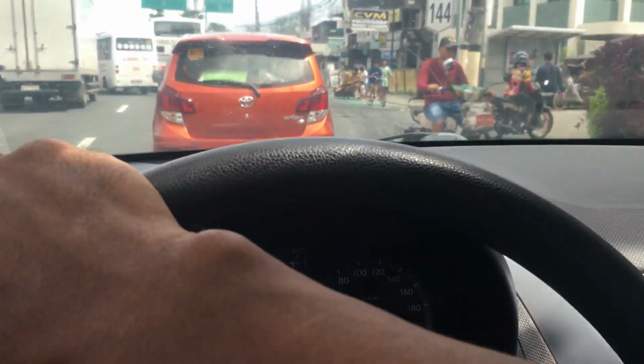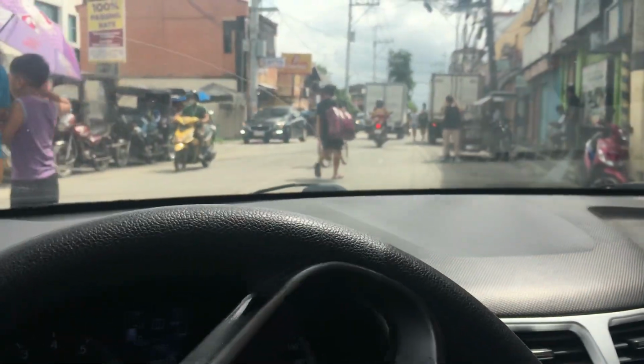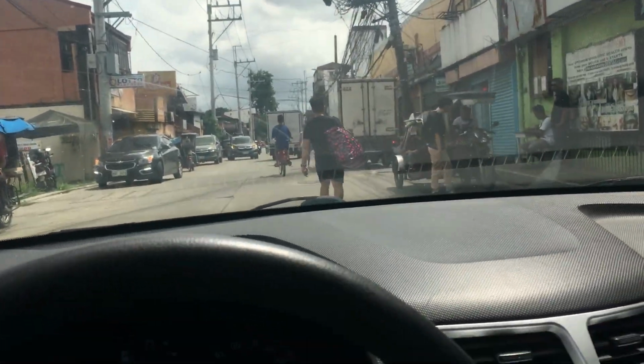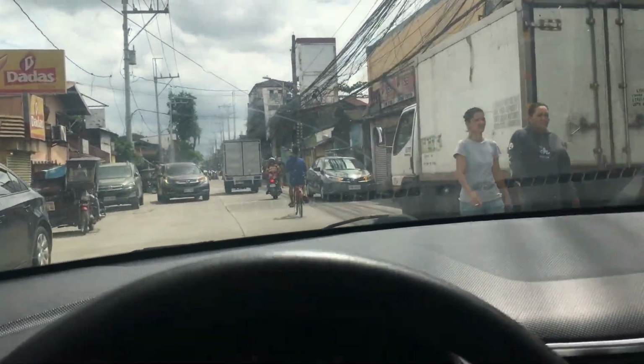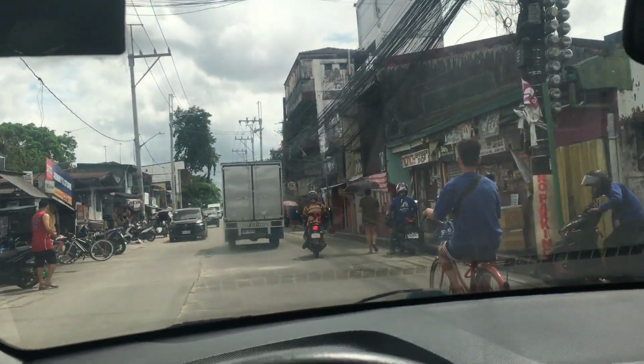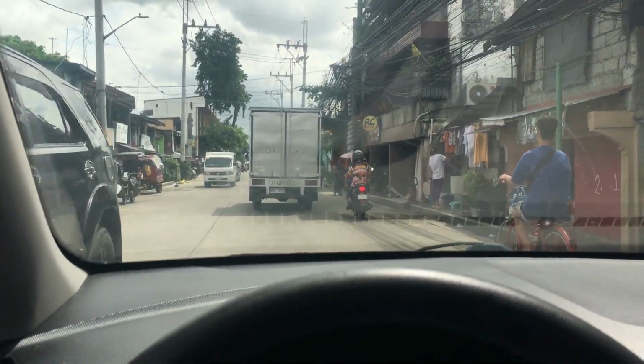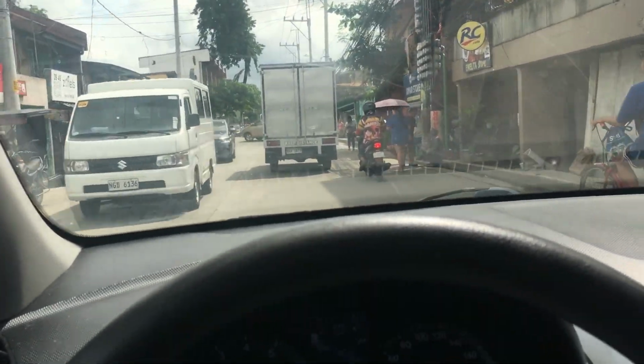So we're gonna go to a major highway here and test drive it. I need some distance. From what I'm seeing here, it seems to be getting better the longer I drive it, the hotter it gets, so that's good news. Our misfiring: I did switch the number 1 to number 4, and the 4 is not listed here. That tells me the coils are bad, so I gotta get 3 more coils. Damn it, I thought I could get away with 1, but I guess not. So I'm getting close, but I'm gonna have to go get 3 more coils now.